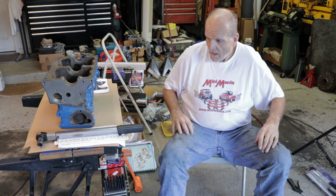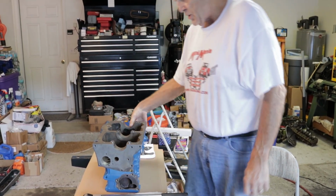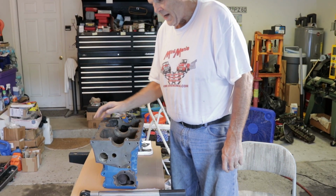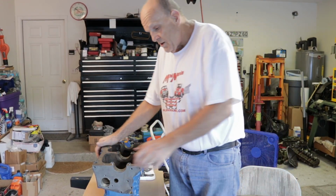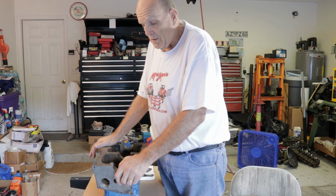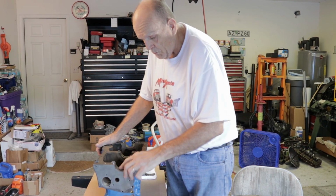All right, we're live. Today on the Mini 1275 motor, we're going to install the crankshaft and the pistons and rods. I'm not going to do the cam because I may be using the cam that's already in the car, so I've got a brand new Mini Spares Evolution 002 cam ready to go if it turns out that the other one's bad. It's a Swift-Tune SW5 in the car, and it's a pretty nice cam, but I'm worried that it may have damage from some of the lifters that are in there, so I'm prepared either way.